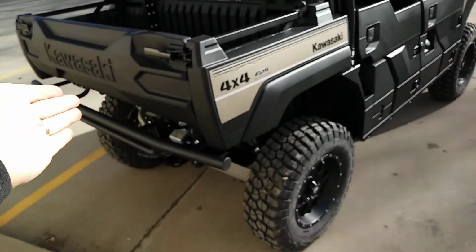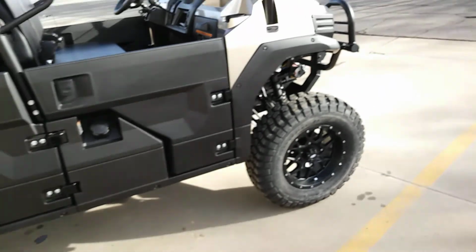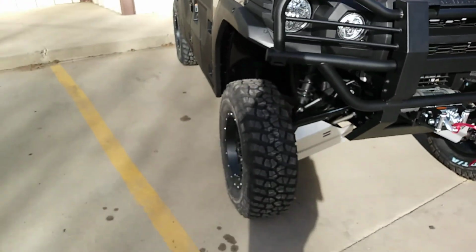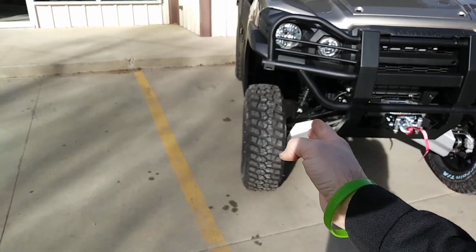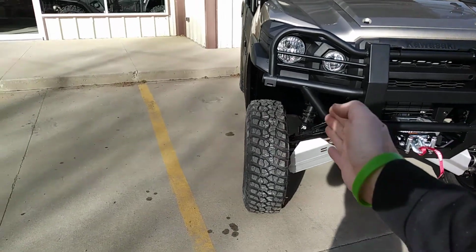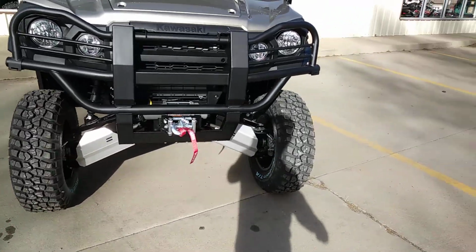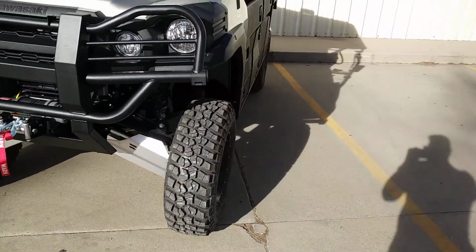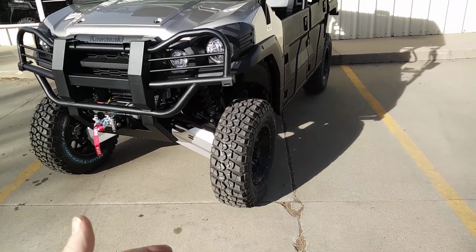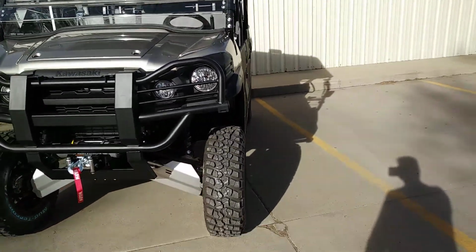We got the rear bumper. We got ITP Hurricane wheels, which are a really popular wheel. Nice setup. It is a 1-inch different offset than stock. The stock wheels are basically sucked in more. These have a 1-inch wider offset, so we do not require wheel spacers with those wheels, where we use a 1.5-inch wheel spacer with the stock wheels just to bring it back out, so that we have it nice and flush with the body there.